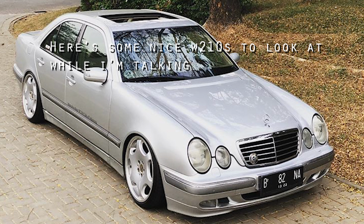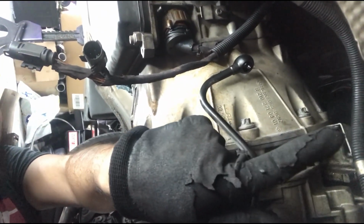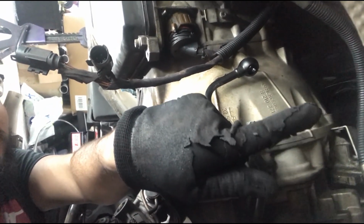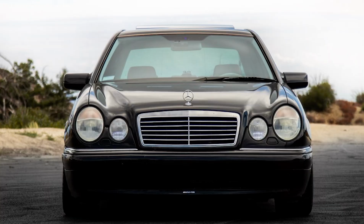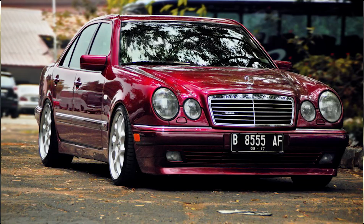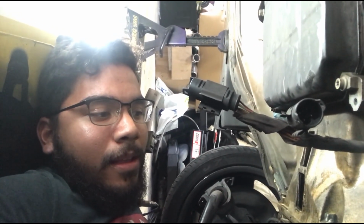Right now, I already got the most top one on the right hand, on the passenger side out. So if you look, I don't know if you can really see, but it's way up there. It's above this one. You see this line right here? There's one more over there. You can barely see it, and you have to get to it by feel, which really sucks. And please make sure, if you are doing this, that the socket is all the way in, because if not, you can easily strip them, and then, well, that would suck.